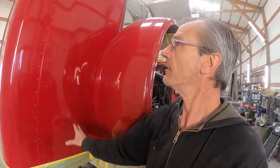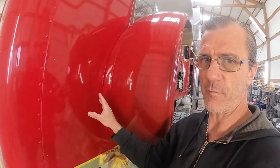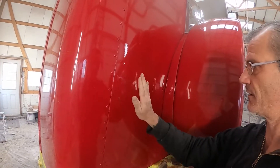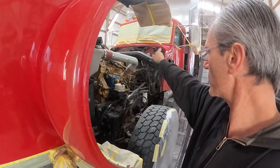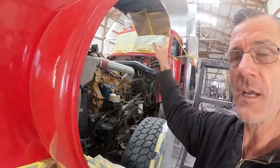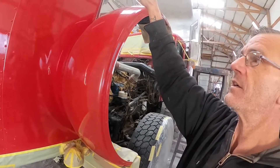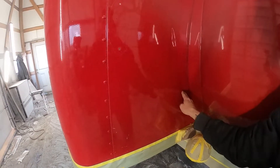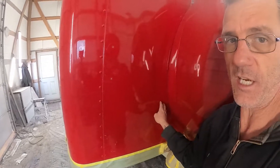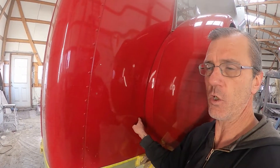The more I survey this panel, the entire thing including what's behind it is just far too great for me to repair, because the whole thing is swayed in about an inch and a half, which means the bottom part back there is swayed out. That's why none of the rollers inside the hood want to go into any of the catches — everything has been altered. The roller cages and roller catchers have all been altered to compensate. It's heavily dished all the way across, and it's behind a brace so you can't shove it back out. The brace itself is bent and made of tube, so if you try to straighten it, it'll just crush.